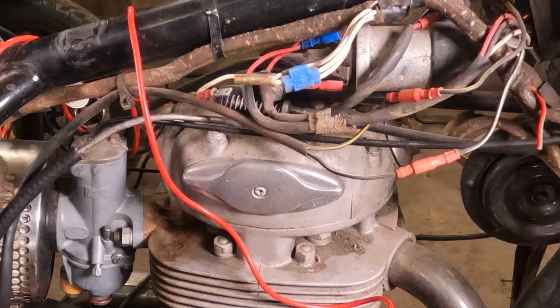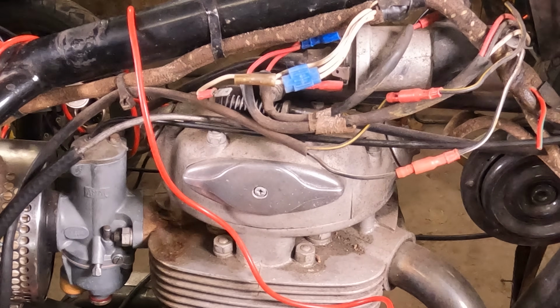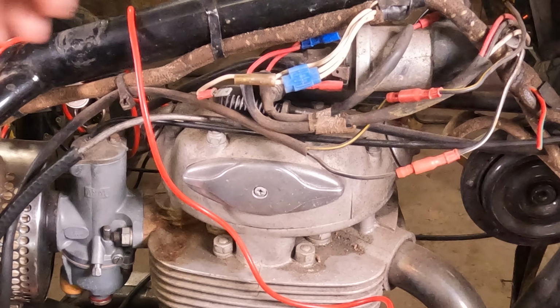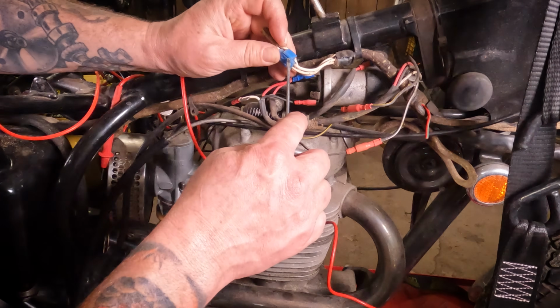But you have two problems. One, you only have a knife edge of contact. And electricity runs across the surface of the wire, not through the wire. So therefore, you also have a point of resistance because you don't have a great contact. Two, you've just cut the wire, or half the wire, in half.